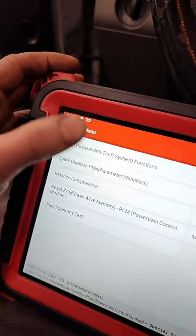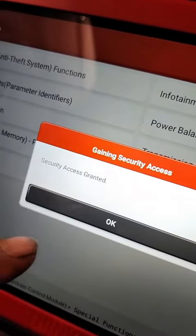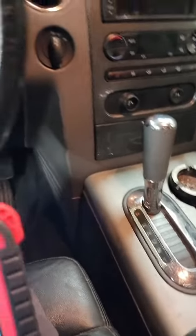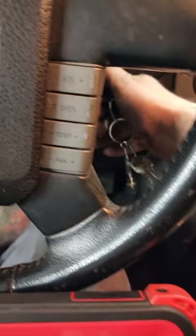Going into the PAT system. We got two keys — we'll be back in 10 minutes. Okay, we gained access. We want to erase keys, so you have two keys. Stick the other key in there, three seconds, turn it off.